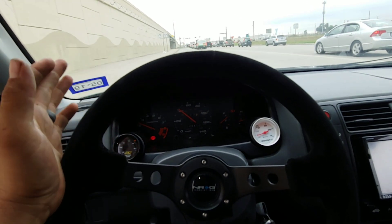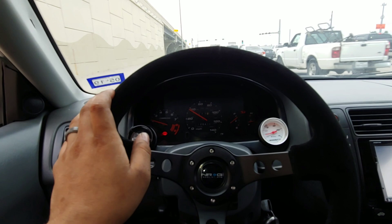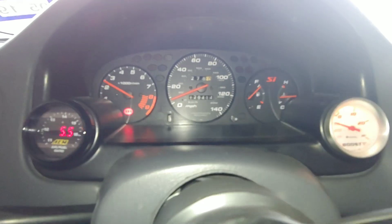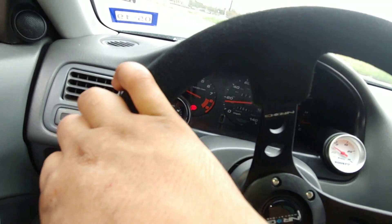As I was saying, I don't have a lot of time — the car has a blown head gasket and it uses coolant pretty quick when I'm boosting around. So I'm going to make a couple pulls and see if I can get it down to 11 AFR fast. It probably has low compression; cylinder one seems to always have the head gasket issue. But it's only losing coolant — it's not mixing oil and coolant — which is the only reason I'm still driving it. I've got a wide angle lens set up so you should be able to see all the gauges.